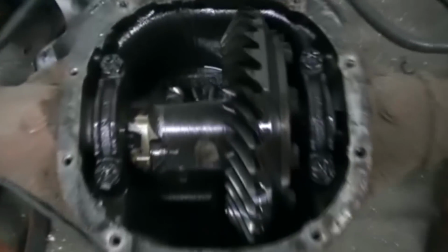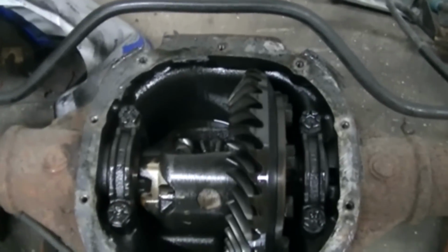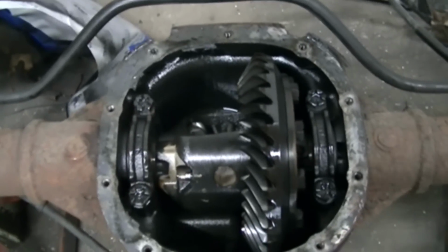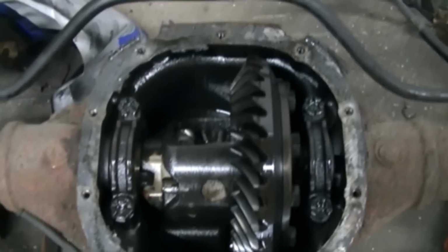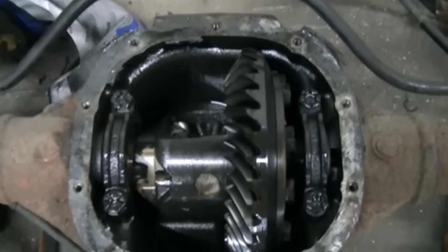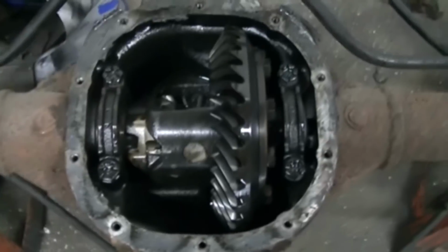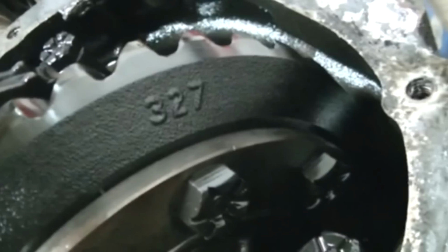And number 3 should be this right here. You gotta get new gears, man. And while you're getting some gears, get an LSD. You know what I'm saying? That's what you're gonna need for your Crown Victoria. Mind you, get the Ford Racing ones, all right? Don't get the aftermarket, any other brand. Support Ford, man. Got Fords, put Ford stuff in there. And also, you see the gear right there? 3.27.